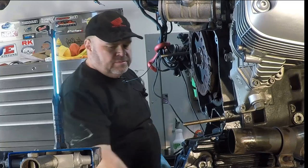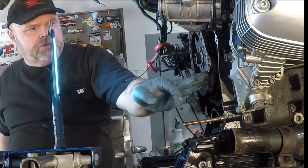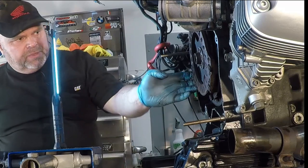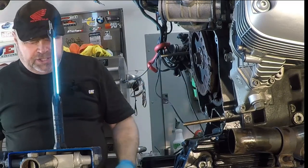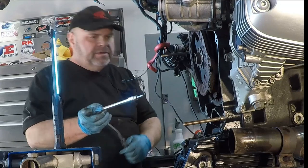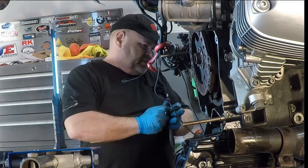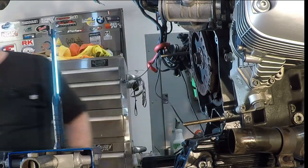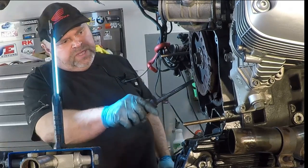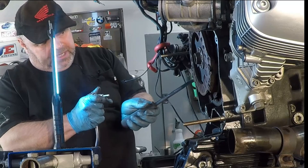Now we can take that apart to see. So the clutch is held on with these six bolts right here. And in order to remove those bolts, we just need to unthread them. But the issue is you may wind up turning the engine and finding it difficult to get any leverage on these bolts. So one of the things that you do, there's of course another BMW special tool, because there always is, to assist with that. Or you can just take your pry bar and just kind of gently hold it against the teeth. Don't reef on it, you don't need to do that.